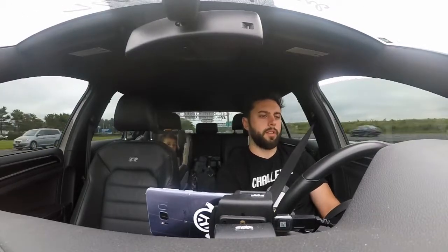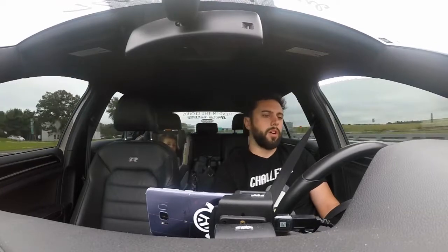I've come to the conclusion that with the DSG models and their gear ratios, for torque, you want to shift around 6,300 RPMs going into the next gear. It might change with every gear. I kind of calculated it down to the T almost. I had to pull out the nerdy math for it, but 6,300 seems to be the sweet spot for how the torque's going to be in the next gear, and whether it's even worth redlining it, which 6,300 would not redline this car. This car redlines at about 6,500, but if you let it shift by itself, it shifts around 6,700 or 6,800. So that's how you would run a log.